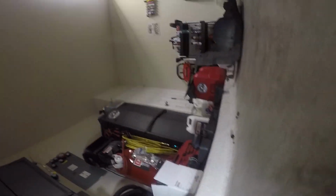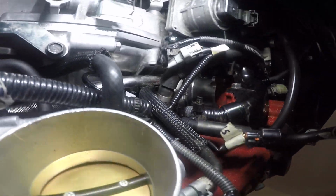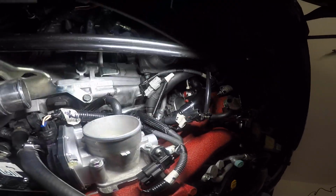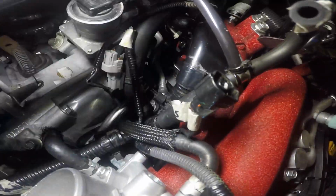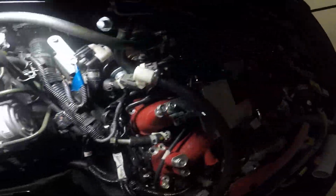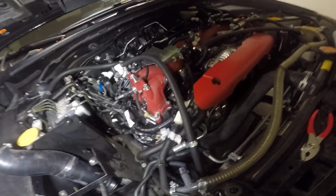For that, if you wanted to, you could remove it, but it's a little hard to get out. So instead of removing it, I just took it apart there at the block, and I'm going to put the block off plate there. And that silver tube runs this way, and it stops right there underneath that other part. So some people just run the block off plate to the tube itself, and they don't worry about putting it on the block. That's probably a little bit easier for some.